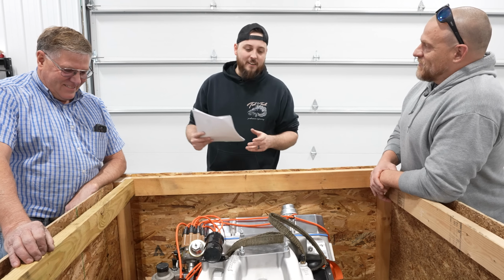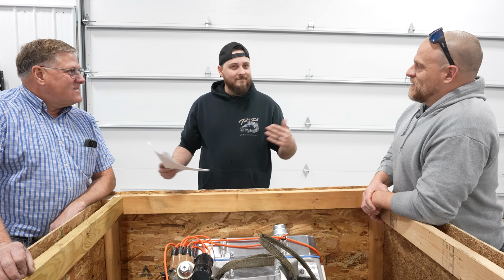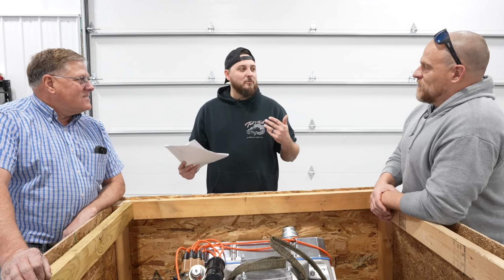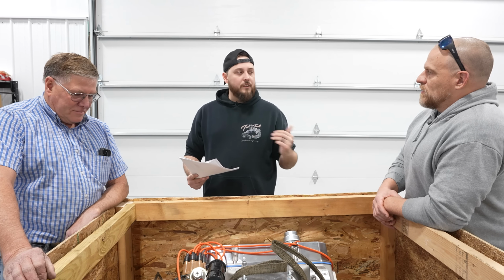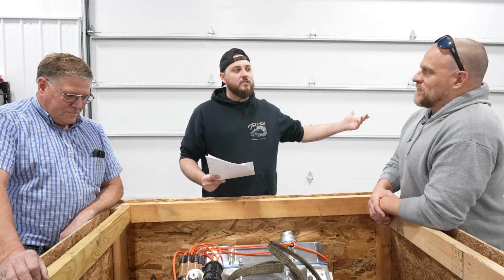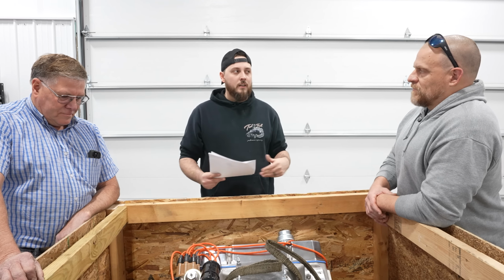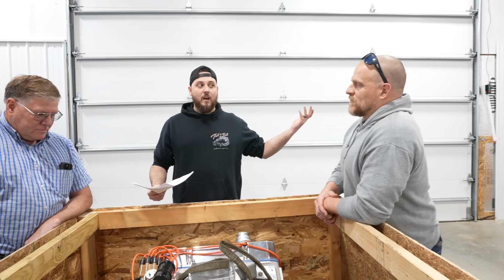But that's kind of where dyno numbers just get murky, and everybody I talk to has a different opinion. So that's where I just wanted to look at the measured numbers and get a conservative correction. We're not correcting to sea level or to a standardized temperature, humidity, and so on. I'm just calling it 3% per 1,000 feet, looking at 5,000 feet.